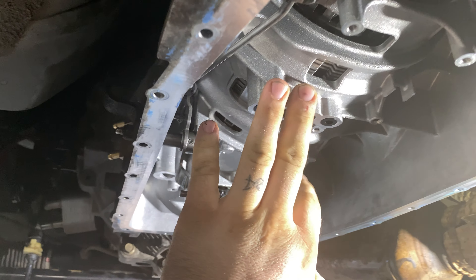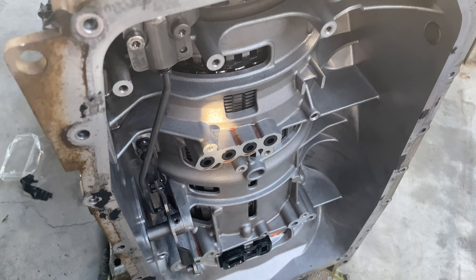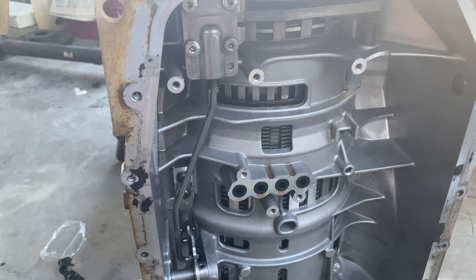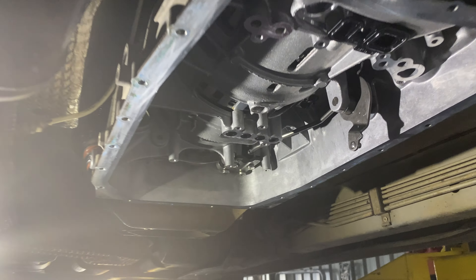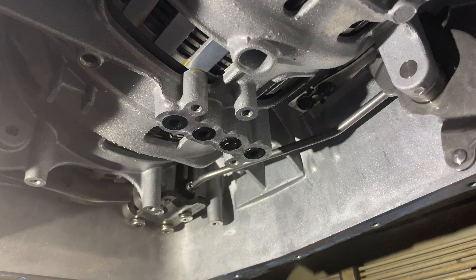As you can see inside the box, it's nice and clean, which is good. My other one that was in this was a little tainted — I'll show you. I don't know if you can notice but it's just that little bit not right, just slightly discolored. I think it was probably from when it was milkshaked. The actual mechatronics unit that was previously in that other box was a little bit damaged — rusty or corroded.